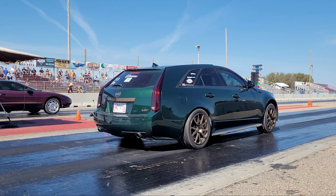We did end up struggling with the ride height a bit and spent at least a few hours slowly dialing it in. Adjusting, setting the car down, bouncing it, measuring, lifting the car up, adjusting, setting it down, bouncing it, back and forth. If we were to offer any advice, it would be to set it at least 3/4 of an inch higher than what you'd want it to end up at. Once it settles and you've gone through everything, it'll probably only need to be adjusted down a hair, which would be way easier.